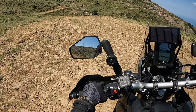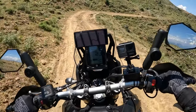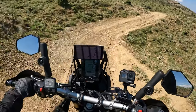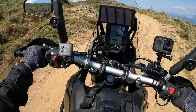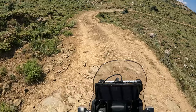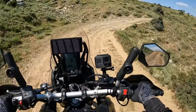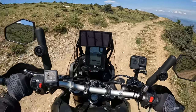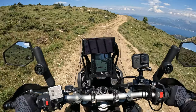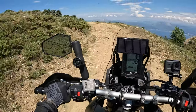It's a very stiff tire as well, with very big lugs, which means that it will slip in rocky terrain, and it will slip in mud, but nothing you can't handle. The only thing you shouldn't be expecting of this tire is that it will excel off-road. It is very stable at high speeds. You can do highway runs on this tire and it will work fine.